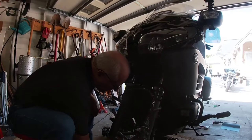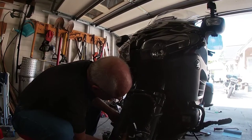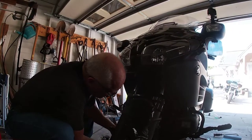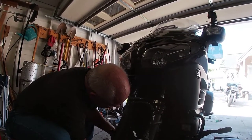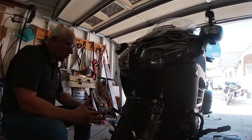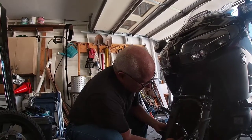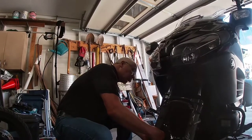So what I normally do is I take the first one and clip it first. There's a little clip right there — you can even hear it. Clip that first one. And you remember — the whole mechanism, these brakes are floating. So the mechanism itself, as you can see, this whole thing literally slides back and forth. So while you have it off, you can grease those sliders.